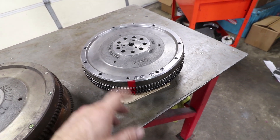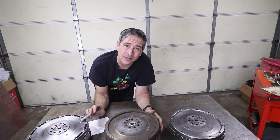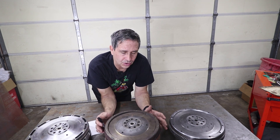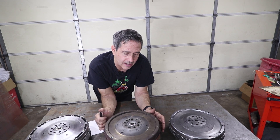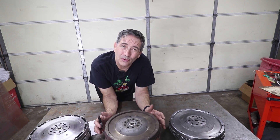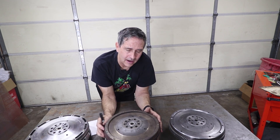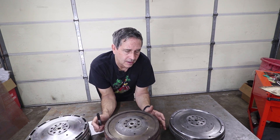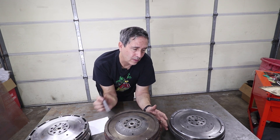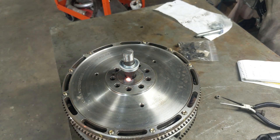I had this one balanced prior to going into Mac. It's kind of interesting to see the evolution of the Porsche story and even today with some of the aftermarket components available. I think they went with the bigger diameter disc because they needed to handle the additional torque from the 3.2 liter and also the 3.6 which was coming in the 964. Having a bigger diameter clutch meant you didn't have to have a stiffer clutch pedal to handle that torque. They also increased the weight, which gives a little better feel of the car. The cars were getting heavier so you needed more weight to get off the line — it makes it feel smoother, maybe a little more sluggish, versus back in the day with the lightweight pressure plates the factory was providing for a more nimble, quick feeling.